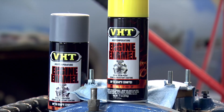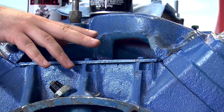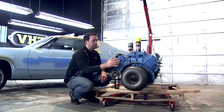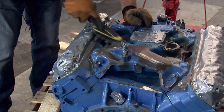We're going to paint our engine block with VHT's gloss yellow engine enamel, but before we can get started, we need to make sure that our engine block is nice and prepped and ready for a fresh coat of paint. To do that, we're going to want to sand down the areas where there's some light rust, and make sure any areas with chipping are nice and smooth. We'll then go to our VHT gray primer engine enamel, lay that down, and then lay on our gloss yellow engine enamel. We want to make sure we get rid of areas with loose rust, and any areas where there's engine enamel already placed, we want to give a light scuff with our scuff pad.